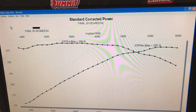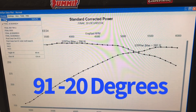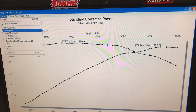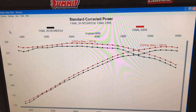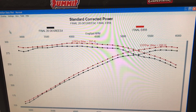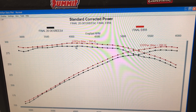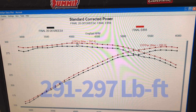Now let's see what happened when we put E85 in this thing. Our highest timing level was 20 degrees on 91 octane. When we replaced the 91 with E85, we did pick up power and we ran it at the same air-fuel ratio. We're running at the same AFR on the gas scale, which means we had to supply a lot more E85 to achieve that ratio - we're burning more fuel, but we did pick up power. Peak power went from 282 up to 289 horsepower, and peak torque went up from 291 to 297 foot-pounds.